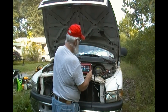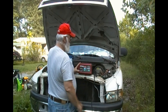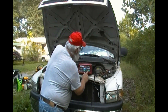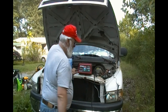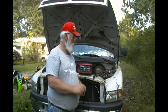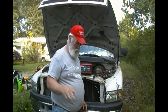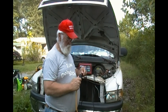I'm going to set this to regular battery — not AGM. I had to read the instructions to know what AGM is. Anyway, I want to select quick charge, which is ten amps. If I was going to leave the vehicle alone for months — going out of town, vacation, or over the winter — I'd put it on two amps trickle charge to keep that battery hot all the time. All right, let's see what happens when we plug it in.